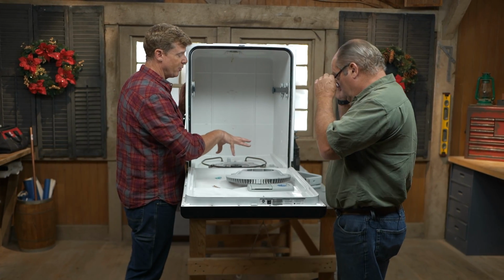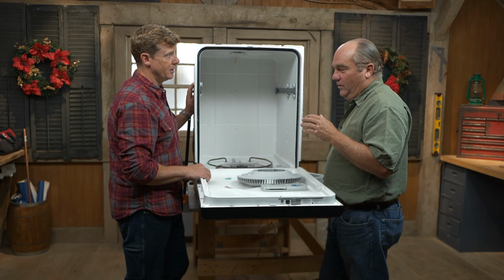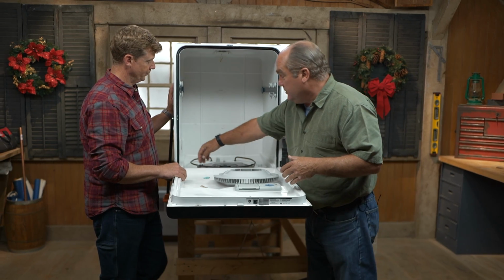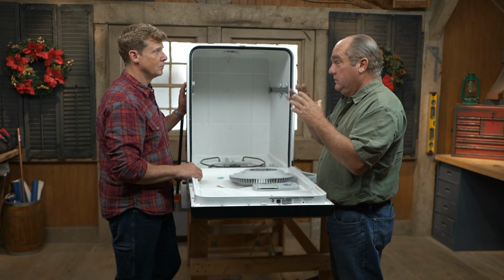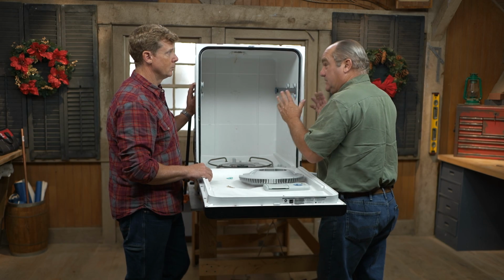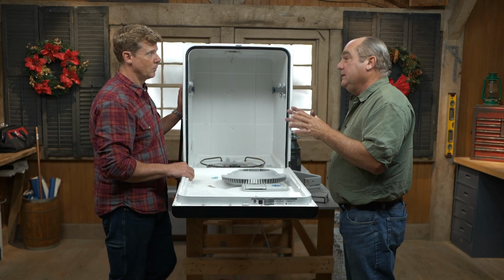And so if we solve the leak problem, what would cause the dishes not to dry properly or as quickly as they should? Well, one of the net side effects of getting more and more efficient is that we use less and less energy. So the heater is less inside. It used to be that there was a much more substantial heater inside this that could dry the dishes more readily. So it's always going to be more of an air drying thing. And when you have dishes that catch water, that means there's standing water that's going to work against you. If it's a stainless steel basin, the stainless steel will actually help you a little bit because the moisture in the air will condense on the stainless much more readily than on the plastic or the glasses. So stainless would be a little bit better, but you're never going to get what you once got in drying of the dishes.